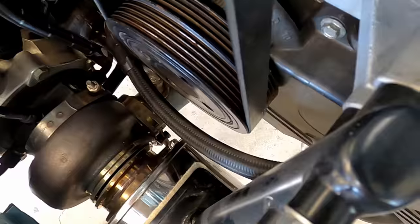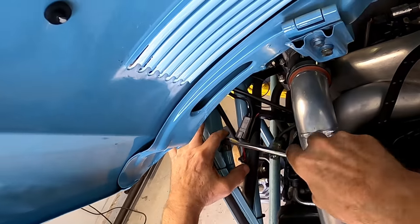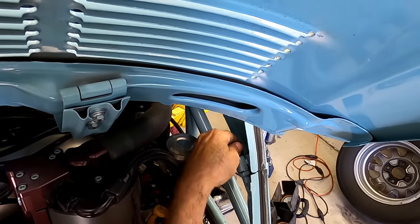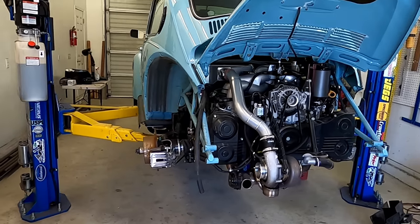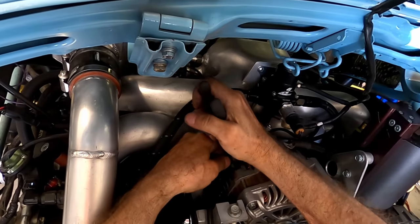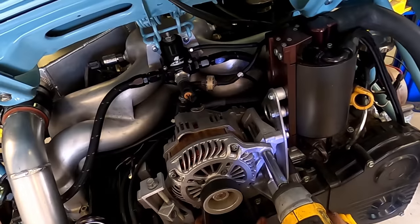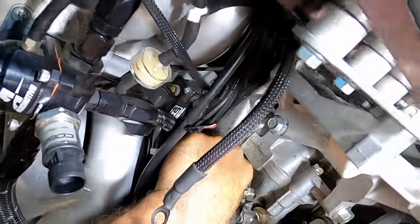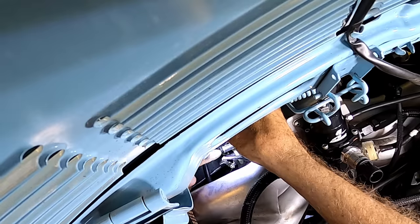Now you can remove the short Vibrant muffler. Off with the air filter. These two three-quarter inch nuts secure the rear apron, which comes off next. Alternator comes out next — use a pair of slip joint pliers to gently grasp the plug. The reason the alternator has to come out is to access several plugs hidden behind it.